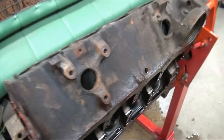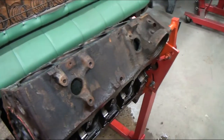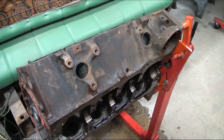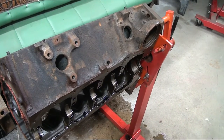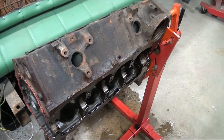For the most part, those cylinders are pretty clean. What I'm going to do is take it out into the driveway and just squirt these water jackets out with a hose and clean all that residue out of there, just so it's nice and clean. This block will get hot tanked and everything done to it.